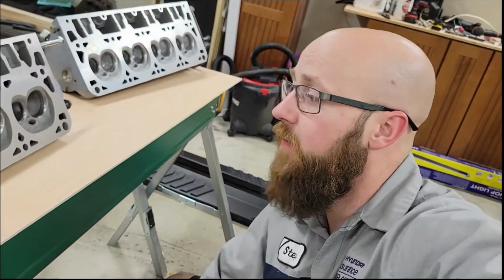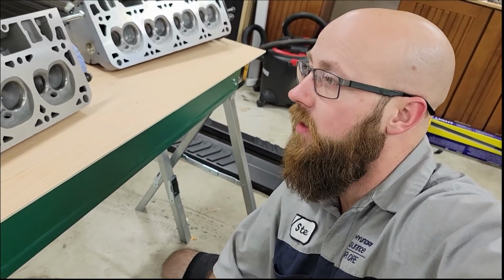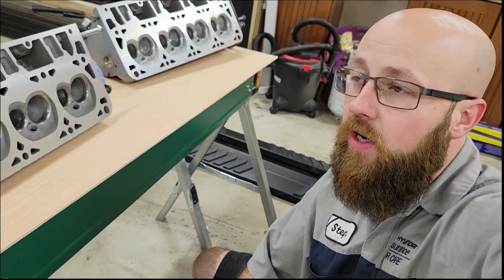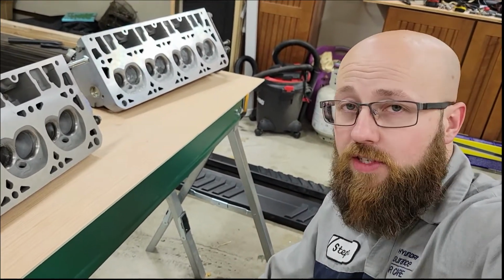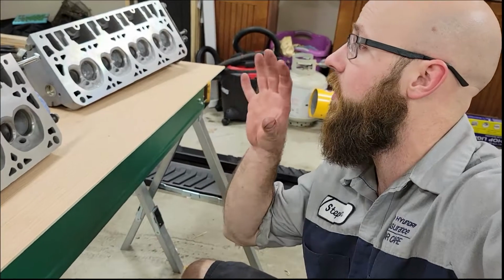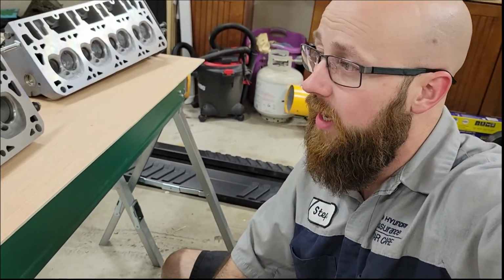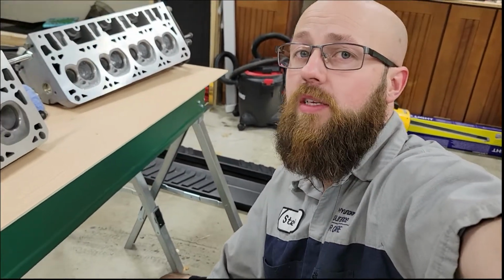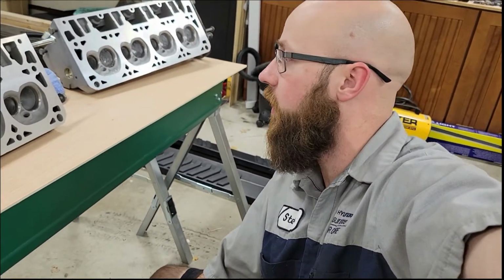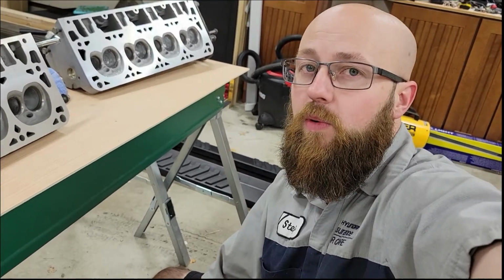He had previously had a rocker arm failure that broke a couple intake valves, and we just had a bunch of issues out of his other heads for his WS6, so we were putting the 799 heads on. Before I install them, I told him that I would do some porting, some cleaning up of the intake ports, just to free up a few extra horsepower before we throw these things on there.